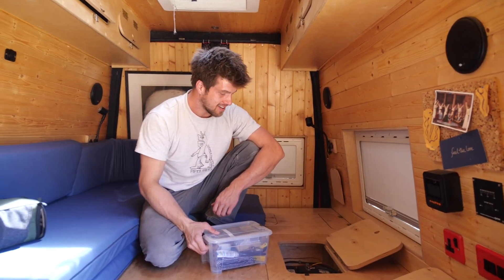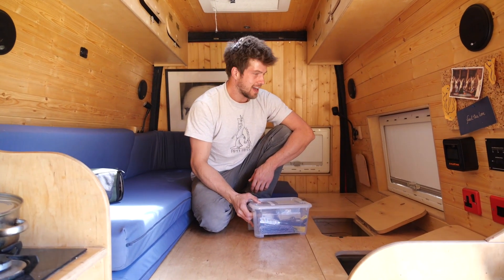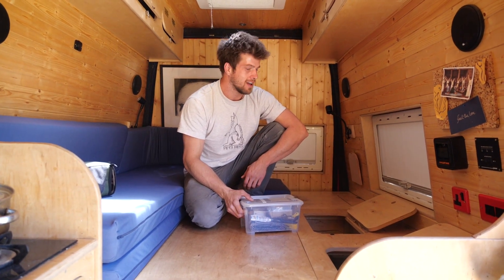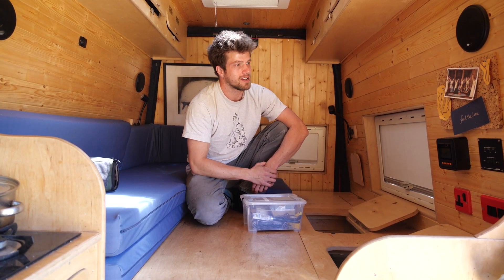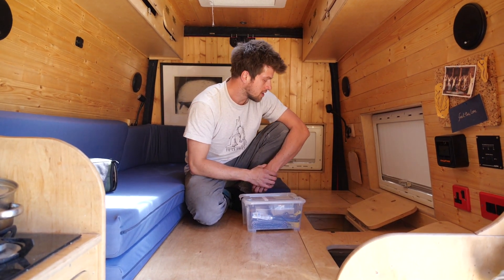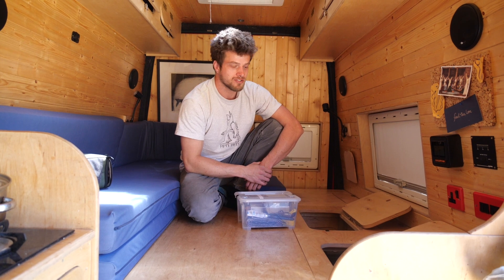So what's going on, Ez? Why are you changing your batteries and what's your problem been? Well, we went on our first van trip for a good few months a week ago and I realized my batteries are completely dead - from a couple years of use. I had AGM batteries and maybe I didn't have quite as much as I needed, so I was constantly running them right down to like 11.9, 11.8 on a regular basis - 11.5, 11.4 as time went on. I just ran them down too many times for too long and it killed them.